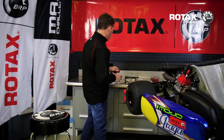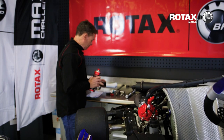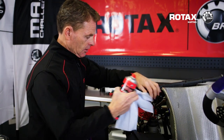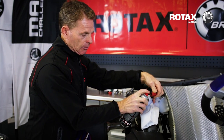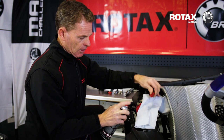To reduce the effects of any further misfire, we can clean our spark plug cap. To do so, we need some brake cleaner. Take our brake cleaner and cleaning rag over to the cart, remove the spark plug cap, place the rag underneath, be careful of your eyes — don't get any brake cleaner in your eyes — then spray nice and clean.